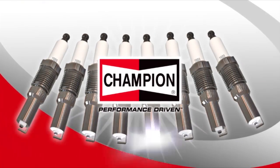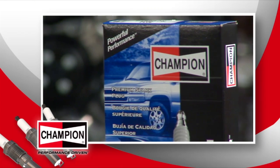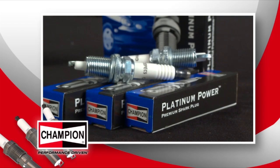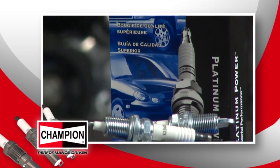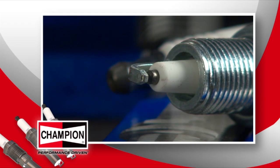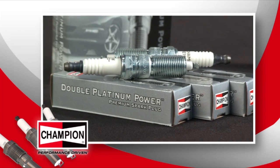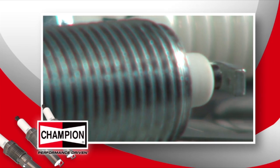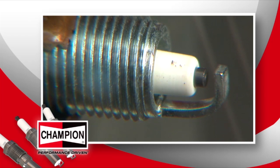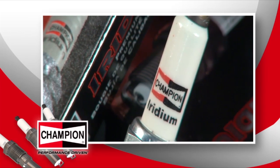Here's this week's Spark Plug Tip, brought to you by Champion Spark Plug. When using Platinum Spark Plugs, there are many designs available in the repair market. The two we're going to look at today are the Champion Platinum Power Plug and Champion Double Platinum Power Plug. For vehicles equipped with copper plugs as standard equipment, these Platinum-style plugs are an upgrade from stock and will extend the service schedule. Champion's Platinum Power Plugs feature a Platinum Pad welded to the center of the electrode, giving your engine long life and powerful performance. The Champion Double Platinum Power Plugs utilize Platinum on both the center and ground electrodes, further extending service life by ensuring minimum wear on both electrode surfaces. Champion is a global leader not only in Platinum technology, but also in the new original equipment standard — Iridium Spark Plugs.